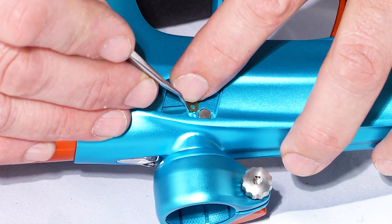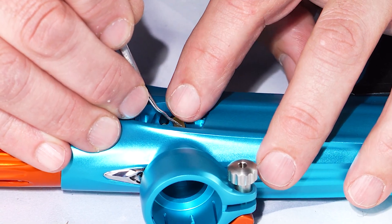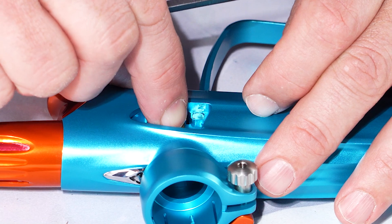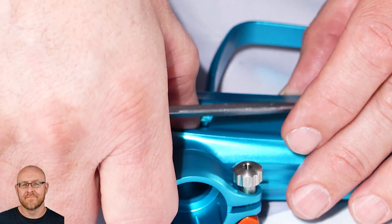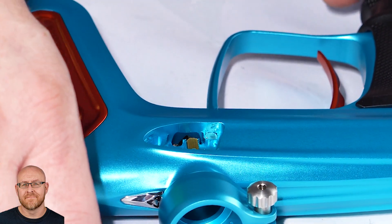Just be careful that you don't break the ribbon. If you want, just set it flat. Yes, use the Q-tip with denatured alcohol and you can clean the eye out as well. When they say denatured, they're talking about isopropyl — 75 or 90 percent, which you can get at a place like CVS.